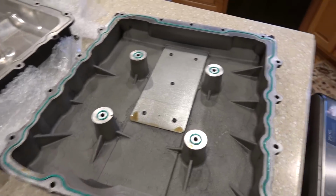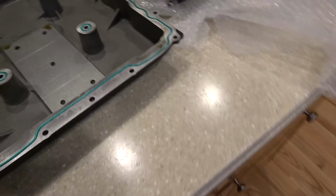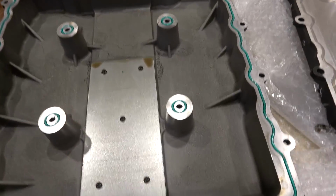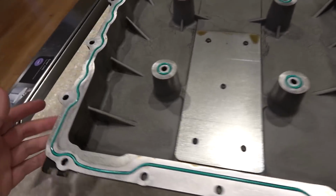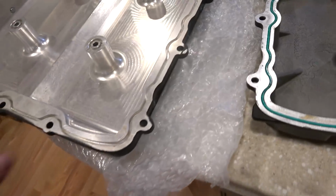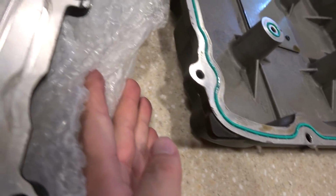In my opinion, if I buy a boosted car, I want to hear the boost from it, whether it's a supercharger or turbocharger. So even without that sound dampener plate, this whole design is just made to be a lot quieter than this one. And like I said, it's heavier, it's more restrictive, it's not as good for heat because of how thick it is compared to the other one. But this one also has ports for meth and nitrous injection. The stock one obviously doesn't.